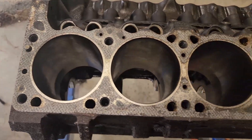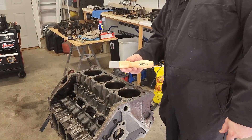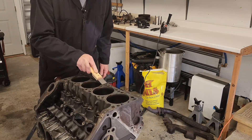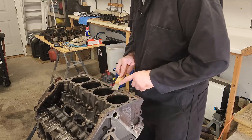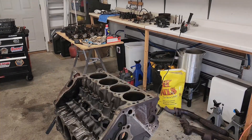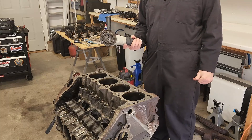The deck here still has a ton of gasket material on it, so we're going to get that off with the super scraper. The super scraper did a really good job, but in order to get these things spotless, we're actually going to run over it with a paint removal pad. I have used this technique before to clean gasket surfaces, so I know it doesn't damage the surface.